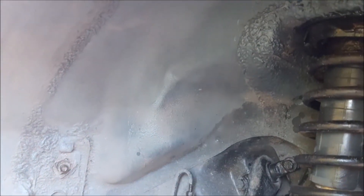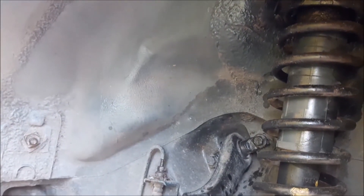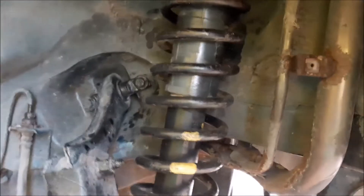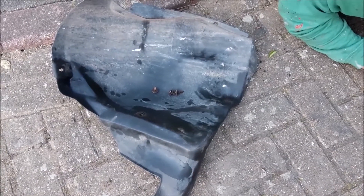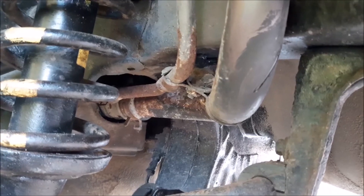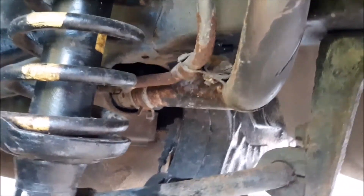Whilst we're painting the back plate, one of the things we noticed is this is one of the Rover 45 wheel arches we haven't painted yet, so we're going to clean that up and paint it. We've also removed the plastic cover that goes over your fuel pipe and vent pipe — a few of the usual Phillips screws. We've noticed just how rusty the fuel pipe and vent pipe are. It's all surface rust, luckily, so it's well worth removing that if you're doing this job, checking it, rubbing it down, putting a bit of rust treatment on and painting it — hopefully saving it before it rusts through.